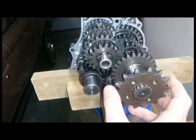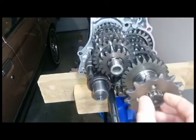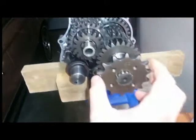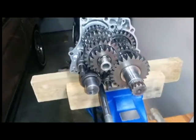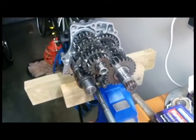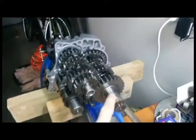When you're accelerating there's load on the shaft so it's going one way, and likewise when you're decelerating. But the more you drive like that, the more this shaft just wears and ends up destroying itself. So this is the whole reason why I'm doing this work — basically I've got to replace this shaft.